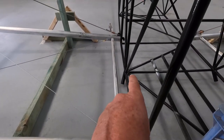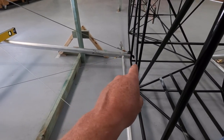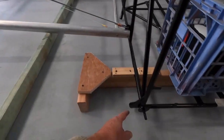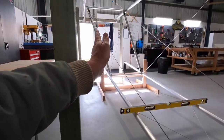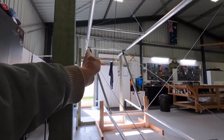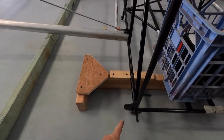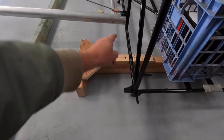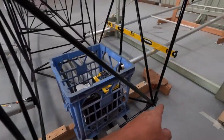You see the undercarriage? You've got a three-way, plus the undercarriage itself — a good joint there. And at the back, the rear spar, there is that carryover. So I'm going to run it — changing my mind — I'm going to run it to the hard point at the front. It'll also keep it square to the wing, so when I pull G's, it's a nice straight pull. I'm going to drill this out to 5/16th and move the cable, which is not crimped yet, to here. Same on the other side with my new cable.